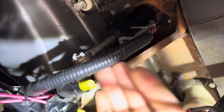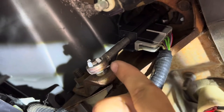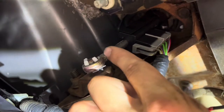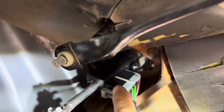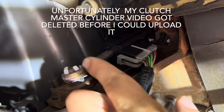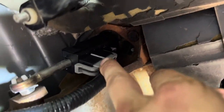Underneath here, I'll turn the light on so you can see what I'm talking about. You can see this white retainer clip. I did put a new one in a couple of weeks ago and it lasted a little while, but my problem is that this clip had worn out. I kept using the truck, and this clutch rod — which goes through the clutch neutral safety switch and through the firewall — rubs on that clevis pin and wears down the back of it. So instead of being circular, it gets worn flat, and you have to push even farther for the clutch neutral safety switch to register that the clutch is engaged.